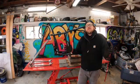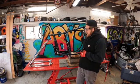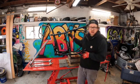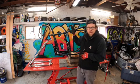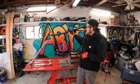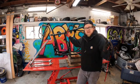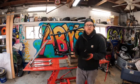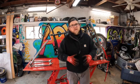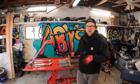And now behind me is a disassembled shovel head. I had to remove the engine, drivetrain, pretty much everything from the engine back. You're not able to do this, or I don't think you should be able to do this, with the engine in place. The rocker cover itself is way too close to the frame, so that warrants the engine being removed. However, I left the front end of the bike on and in the wheel chock just to give it some stability, and I have this propped up on some lumber here.